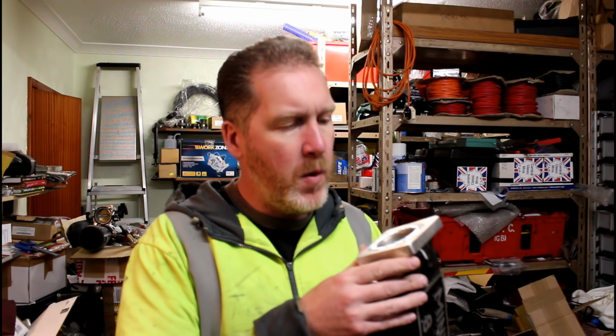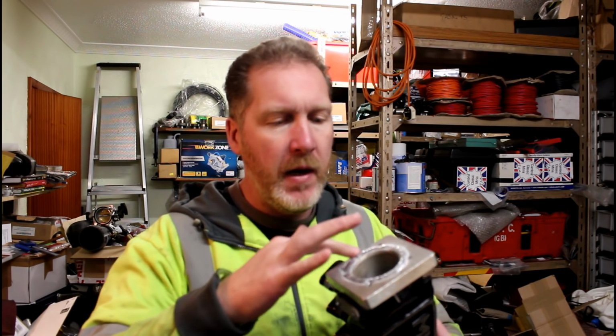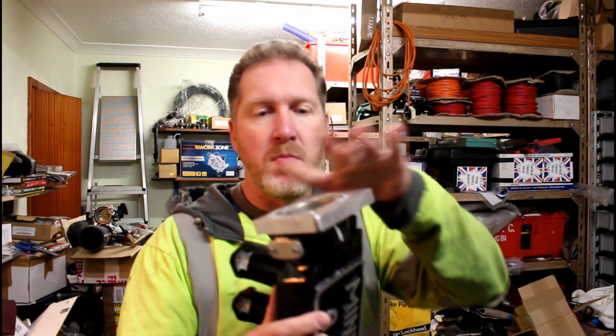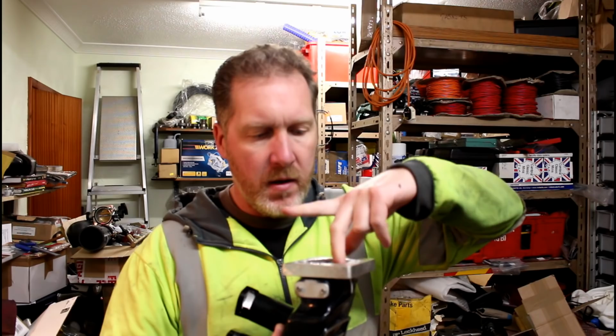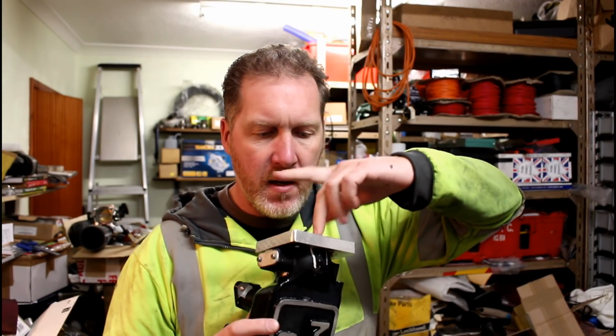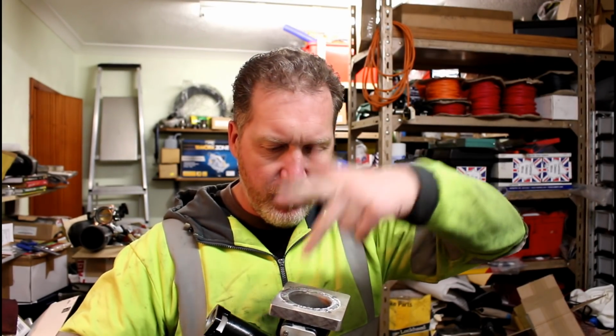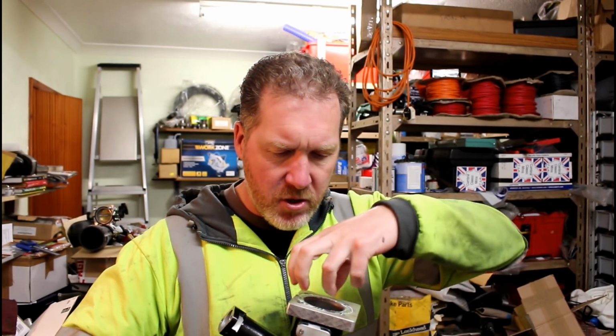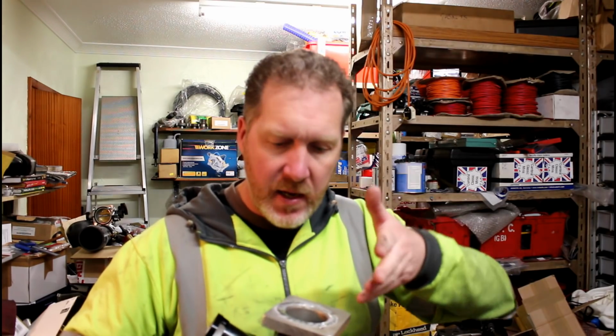This afternoon I took the time off work and went to see Jonathan at JDM Dyno, which you'll have seen on some of the old videos where, obviously, I've been having the minis dynoed, and he welded on my mounting flange to the plenum. See that? And I've just got to smooth it off next. He also did some die grinding inside here to get rid of some of the casting flash, where it was sticking up. It was just where they drilled the bare casting and it needed taking out because it was creating a step.